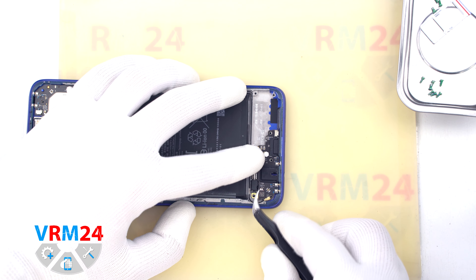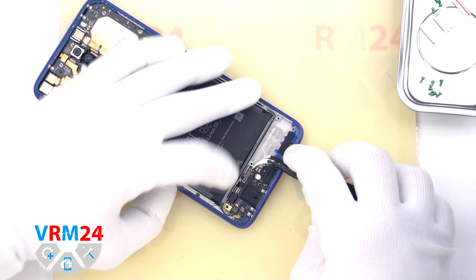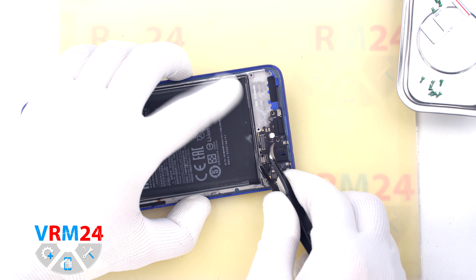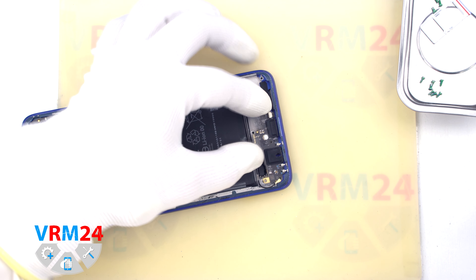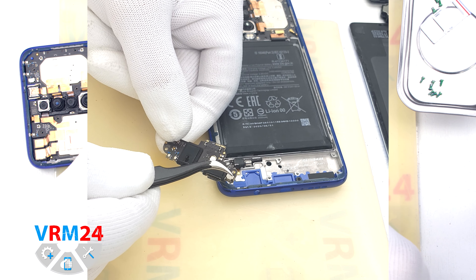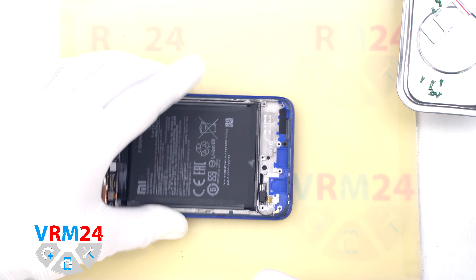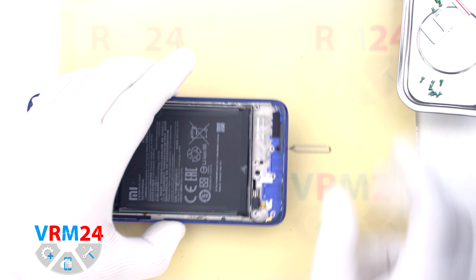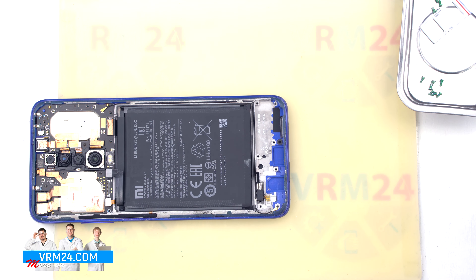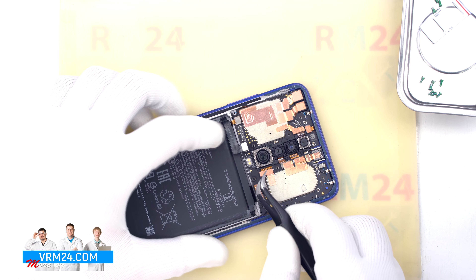We move on to detaching the subboard. We find a convenient place to hook the subboard, which is recessed into the display frame and held on clips or hooks. On the subboard we have the headset jack port, charging port, microphone, and other elements on the inside. In our traditional test, we insert the tool into the microphone hole — there is no protective mesh, but there is a gasket on the other side. The microphone hole is L-shaped and the microphone is located on the other side of the subboard, so it is impossible to damage the microphone through this hole.